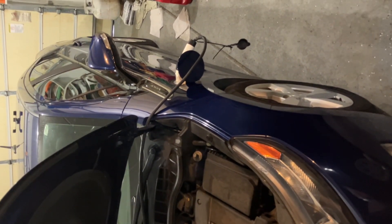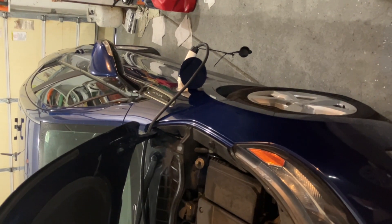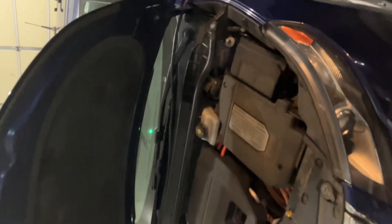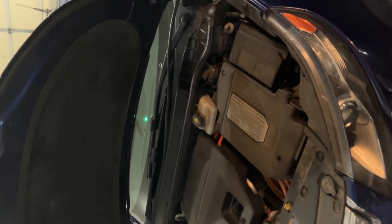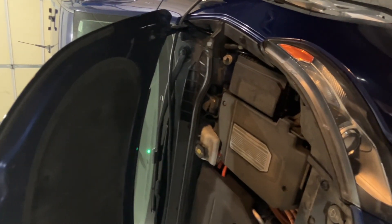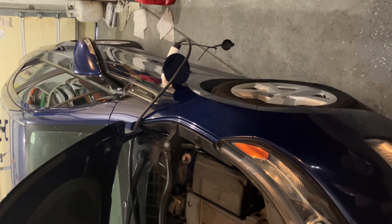This is the solution — try this first before you put a dime into these cars. There are charging problems with these types of cars, but this is the one that worked for me. To summarize: the car just wasn't charging, there was no check engine light, but there was a flashing indicator on the charger saying it wasn't charging. Cleaning the charging port with Q-tips was the fix. I hope this helps people out and gets you on your way.